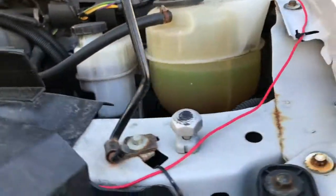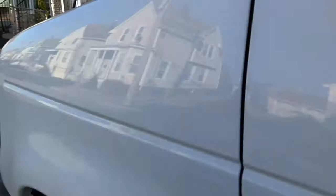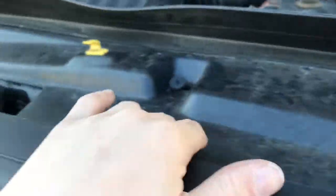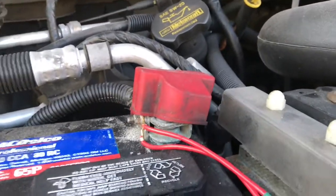We bought it off Amazon for $21 and I wired it up to a switch right there so I can keep the factory horn. How I did it was I popped off this bottom piece, grounded one side of the wire, ran it through here, through there, to the door jam, up, under here, through there, all under here, and I ran the wire — positive to the battery. As you can see, there's all the wiring underneath: got your relay, your fuse, there's your compressor, and your two air horns, so I just wired that all up.